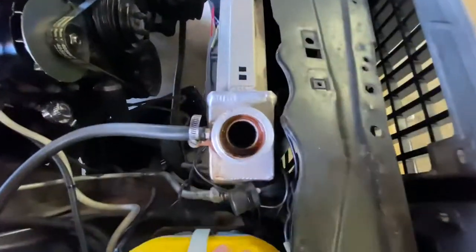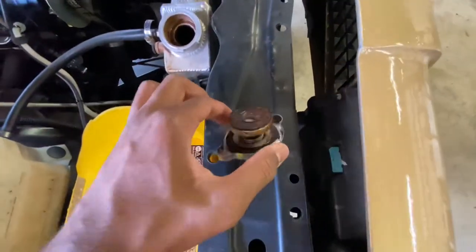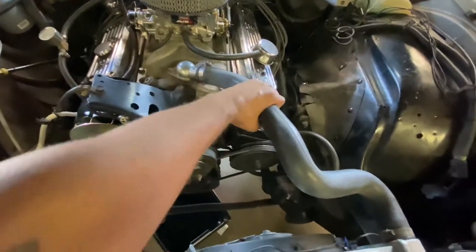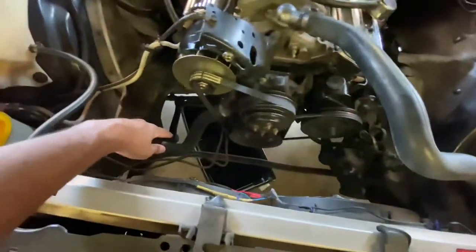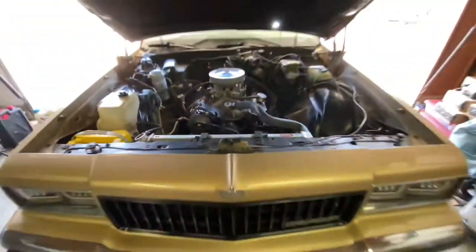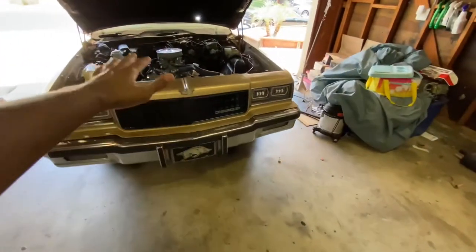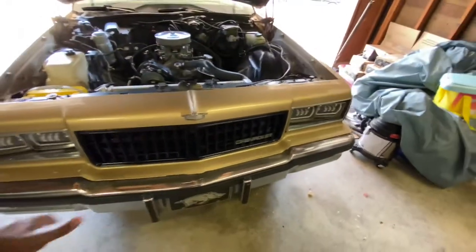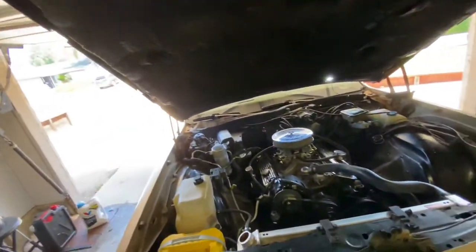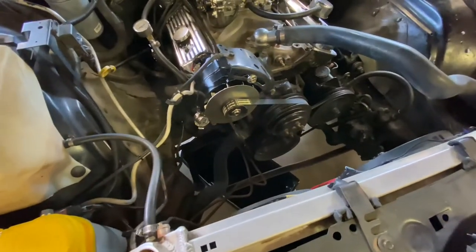It's super dirty inside. You probably can't tell, but if I shake the car a little bit — see that? It's like brown, man. Look at my radiator cap. I can't be rolling around like that. So most likely I'm going to flush it, see what my thermostat looks like. I'm going to take this hose off — brand new upper hose, brand new lower hose — drain it, let it drain, hook up my water hose to it, flush it out. I pulled my car out the garage a little bit so I'm still in the shade but I can get this area wet and push that water out. Let me stop talking and get to work.